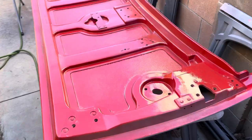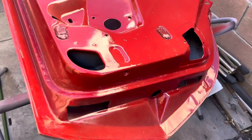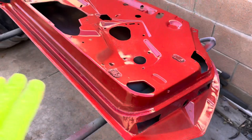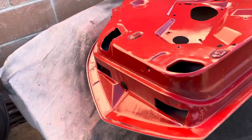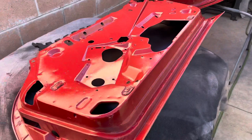Okay, I just wanted to show you guys what one coat looks like. In some spots I'm getting pretty good coverage. It is kind of orange-peely, but this wasn't really sanded at all - it was just primered. I did sand inside the door area a little bit. You can still see it needs another coat, so this is going on a little bit lighter. I'm going to put the next coat on a little heavier, because now it has something to stick to. So far it's looking pretty good.